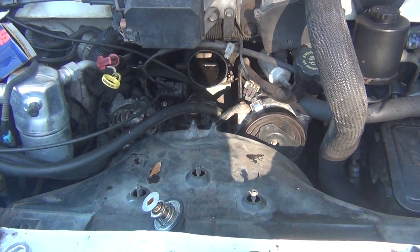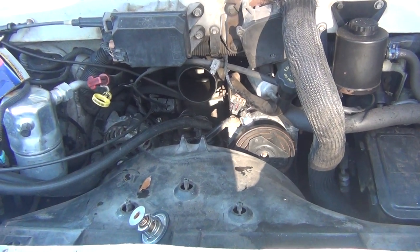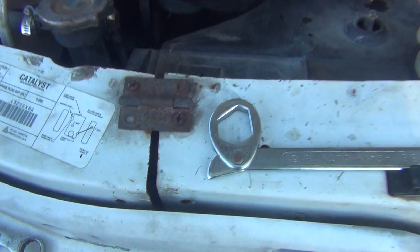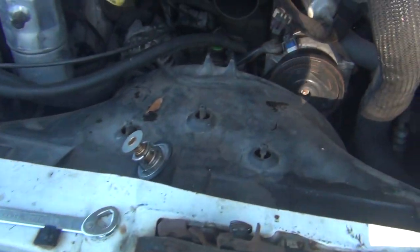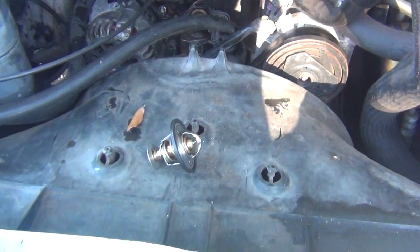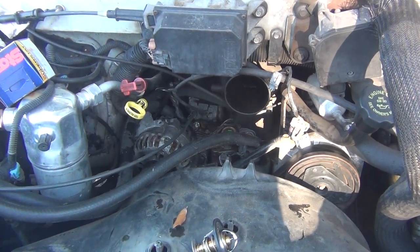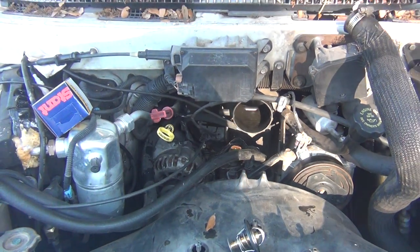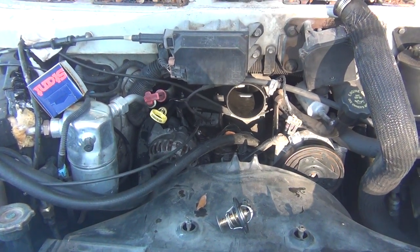This has been a real good van. It's got 326,000 miles. The last owner had it for 15 years — I think he's the one who put a motor in it. He's probably the one who cut the floor too. It's a rust-free van from California, but they cut right through the floor to get to the fuel pump instead of doing it right and lowering the tank. Now there's a big hole in the floor — the hole's almost twice as big as it should be. I'm gonna have to go to LKQ and cut a piece of floor off another Astro van eventually.